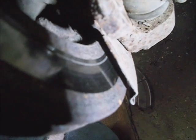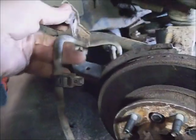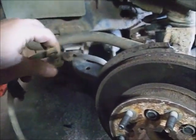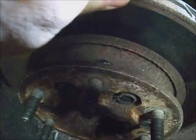And something I noticed, the rotor's rotten. It's just stopping with the center of it on the inside pad, and the rotor's just rusting out. It just falls away as the pad hits it, and you can't turn it out of it. It's just rotten. So it's going to get a new rotor and a wheel bearing assembly. And keep a hold of all the hardware on this ABS wire. You never know what will be missing from the replacement, especially on the aftermarket. And here the bearing's loose.